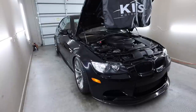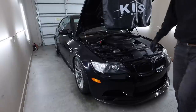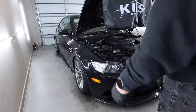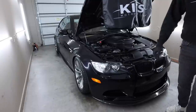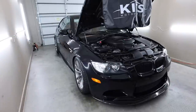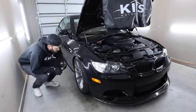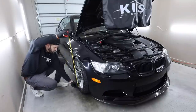The camber is just ridiculous. This thing's probably running like -3 degree camber up front. A little bit of camber is good. I want to run like -2, I think. This has got to be like -3.5. It almost looks like you're rolling around with a broken control arm or something. But dude, I am actually quite surprised at this. There's no way it's even. I think the back is lower than the front, which isn't that big of a deal. I mean, I can go through and adjust everything as I need.